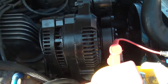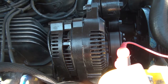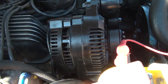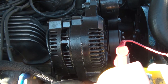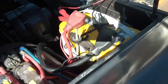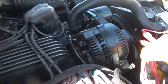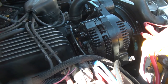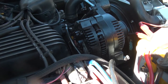Last night I was driving the Bronco and I looked down at my dashboard and noticed my voltage was down to about 12.2 volts, which is a clear indicator that the alternator wasn't working. Good thing I got a brand new battery though — I was able to drive about six miles without shutting off all my extra stuff like the radio, and I was able to get home.